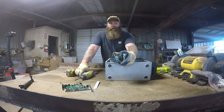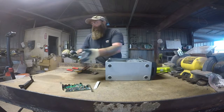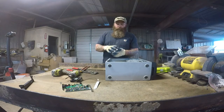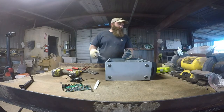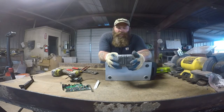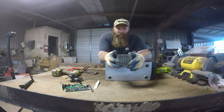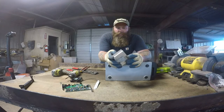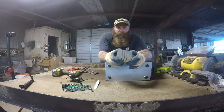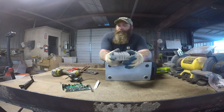It all depends on where you go and where you turn your scrap into. You can turn this in with the fans on them. So we're just going to unscrew it. Take this part off — this now becomes 6063 aluminum, which is actually what this is on the scrap side. It's a higher grade aluminum, it's in the 6000 series category. And it's actually even better if your scrapyard buys painted versus bare extrusion — you can get a premium price. It depends if they're selling to a primary mill or secondary.